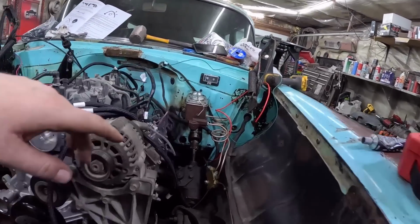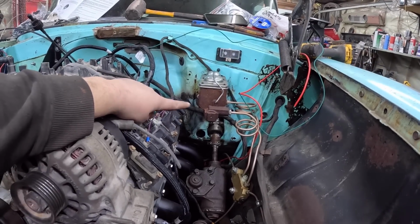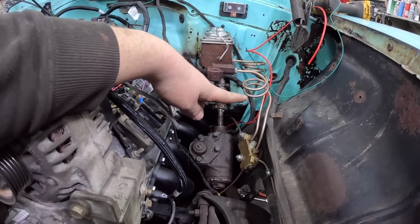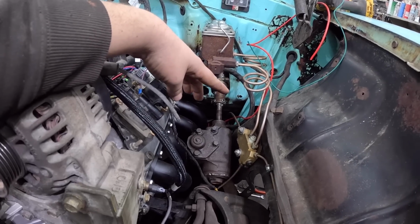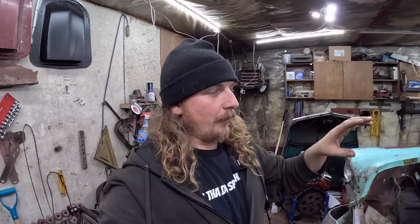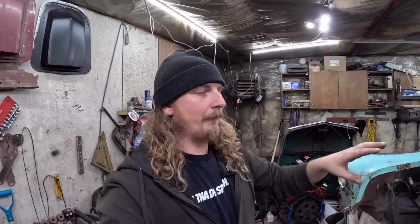We have the fuel line. I ran it really funny. On the 57, I ran it behind the motor, but then it has to run the floorboard, which I didn't really like. This way it stays on the frame rail, and I didn't want it to hug the headers. So we're going to go up around the steering and kind of in that way. It's a bit goofy, and it looks really goofy right now because it's not secured in any way. But this will give really good tie points, so it's not going to go anywhere. Maybe I'm overthinking it, but that's just what I want. Then we can secure it all, and we have a little bit of room, so if we ever want to move anything or change intakes down the road, we have the line there.